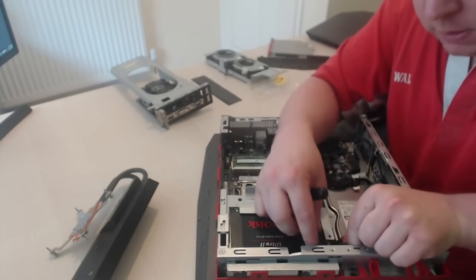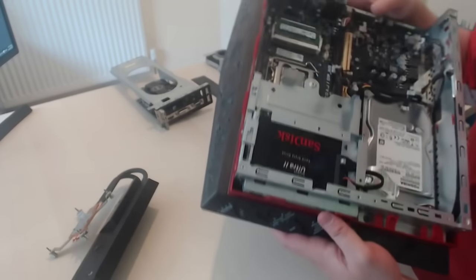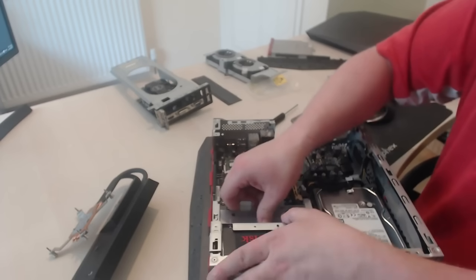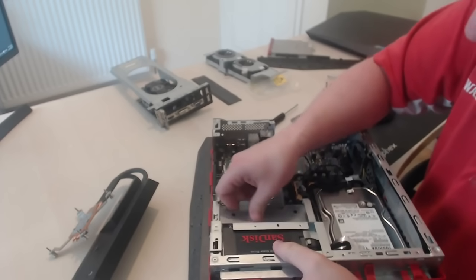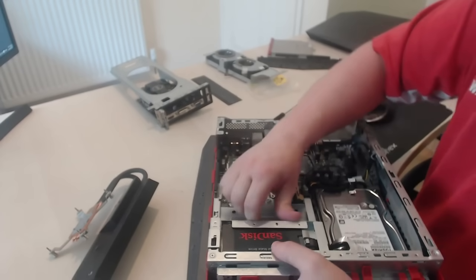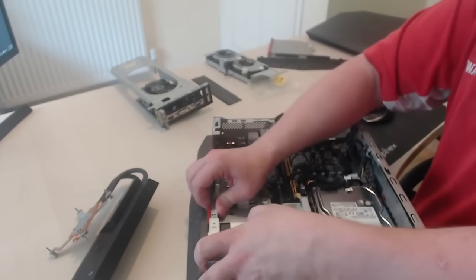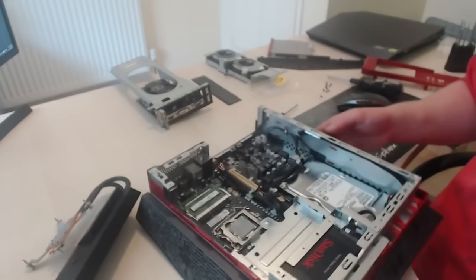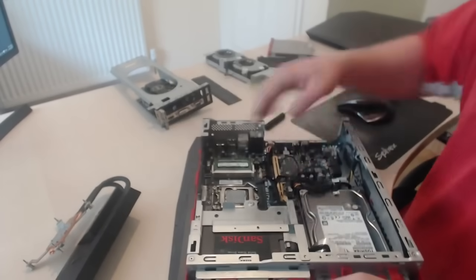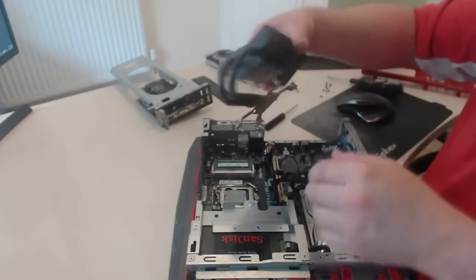Look up the power connections when you get a chance at this stage. So basically you've got the connectors into place and I've taken the entire tray and pushed it back into place. Once you've put the tray back into place as it's situated, this entire compartment is basically ready — follow along to get your CPU cooler again and pop the CPU cooler back onto it.